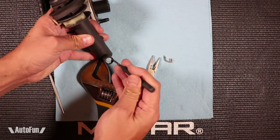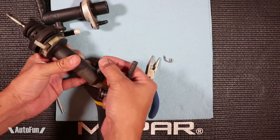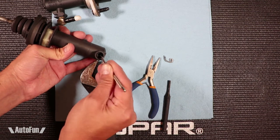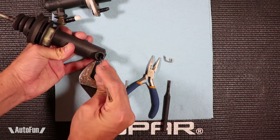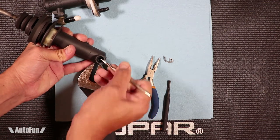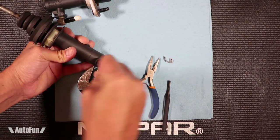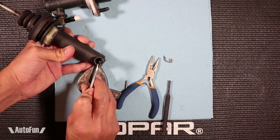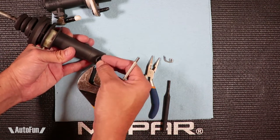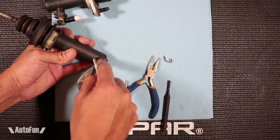This is the slave cylinder where I've already removed the roll pin. Once the roll pin has been removed, you pull the line out. Inside of the channel here, inside this little hole, there's a little rubber grommet. That little grommet — it's possible you might be able to reuse it, but I'd probably recommend getting a new one. You want to get that one out and replace it with a new one if you can. I'm just going to put it back in here so I don't lose it.